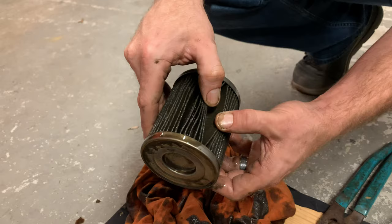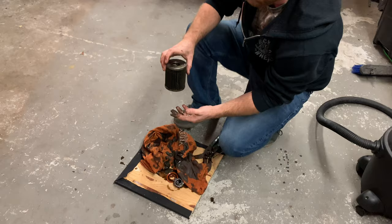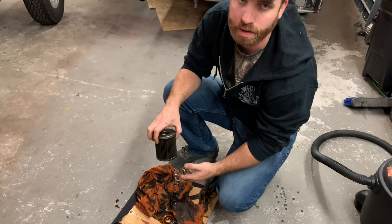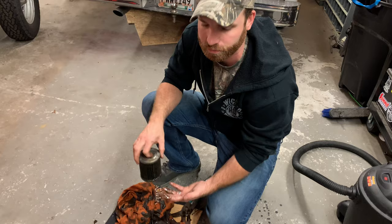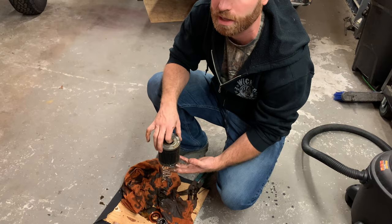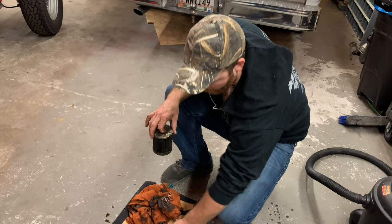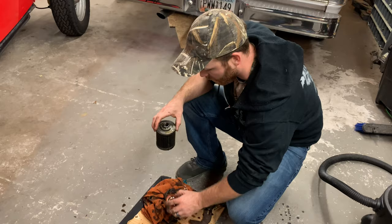You built the engine and stuff gets in there — stuff that's in the old oil cap, it could be anything: moisture buildup, brand new gaskets, new oil, new filter, rubber pieces, all kinds of stuff. I guarantee somebody's gonna comment and say there's too much metal, that's bad. But what you're worried about are big chunks. You know how many pounds of oil pressure this thing holds at idle? It's like 60 pounds — and that's plenty enough to tell me right off the rip this engine is not hurting at all.